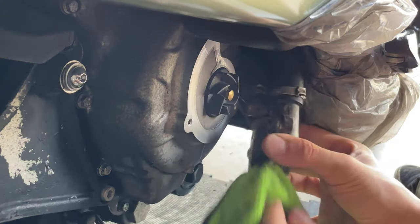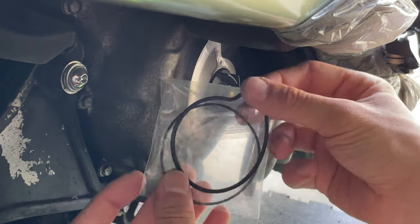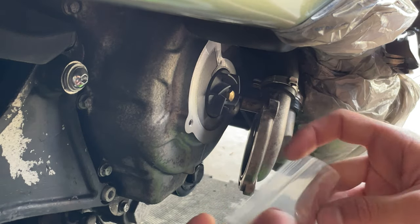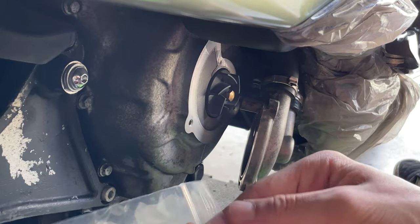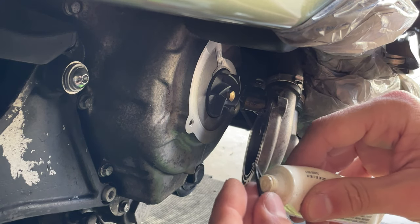Clean up the surface pretty well. You want to have some grease, because when you're installing, they don't make this shaped O-rings anymore. As you can see the shape of it, now they're just like regular O-rings. So for you to hold the O-ring in place without moving, so you don't have any leaks, you want to apply a little bit of grease to hold the thing in place, so it makes the job a lot easier. So you want to grab your O-ring and apply just a tiny bit of grease,